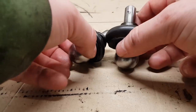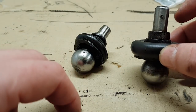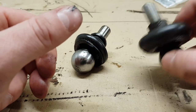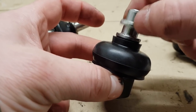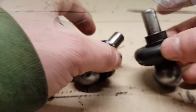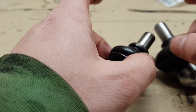The old knuckle joints that came off the car are different. This one is for cars after 1990 because they went to bigger wheel sizes, and this spacer lifts it higher off the ground. You can buy one of these for about £20-30, which is extortionate, or you can buy a shim for about £3. Whoever repaired it previously used the hi-los to compensate the height, which affects handling. So I'm going back to scratch - everything new, everything balanced and the same.